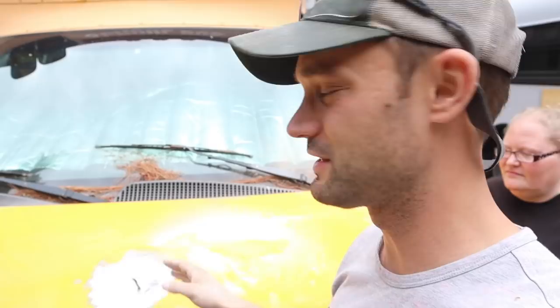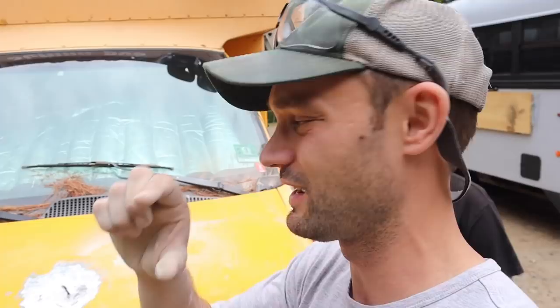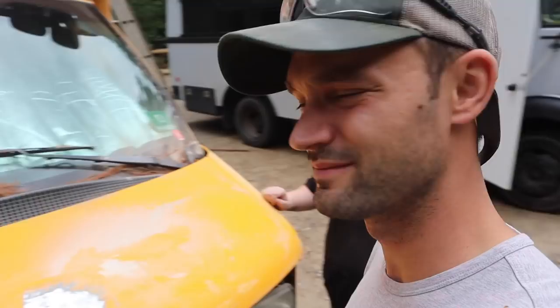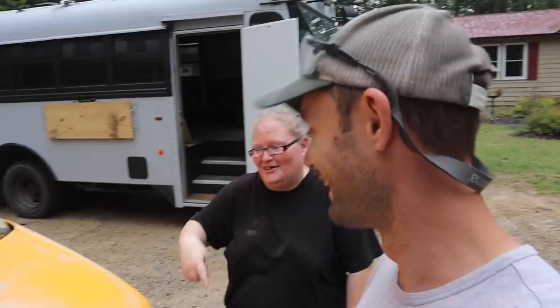John got the inside ripped apart and we found a metal part shielding whatever happened. We peeked in there and realized that at some point someone wanted to fix this and just globbed a bunch of bondo in this hole. I put my screwdriver into it and it never cured because the bondo was too thick — bondo is not meant to be like a half inch thick, it's really less than an eighth inch. Don't fill holes with bondo like that, that's not the right stuff to use. Now that we have a hole here, we're going to have to grind it, weld it, and patch it up for Gina. A lot of the dents are Gina's fault, but this came this way. All right Gina, we'll fix every dent you didn't make — all the ones you made, nope. I'm going to go get my welder and John's going to keep grinding — we're going to see if we can't get this fixed up by end of day.